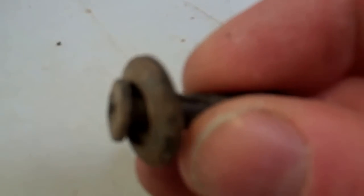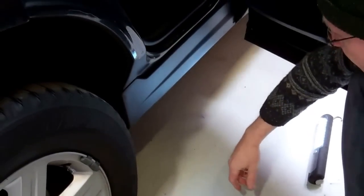If we look underneath here, you've got this crosshead section up in there. Sometimes you can spin out the crosshead and the middle will turn out, but invariably you won't be that lucky. So this is where you use the forked tool — get behind the larger washer section and wriggle and lever, and it should pop out. That's the plastic clip with its insert. So we've got all six clips out from the bottom of this plastic seal panel, and now we should just be able to pull it out.